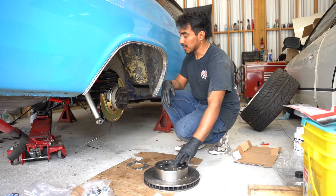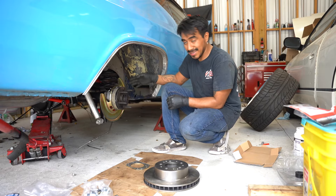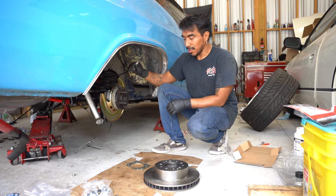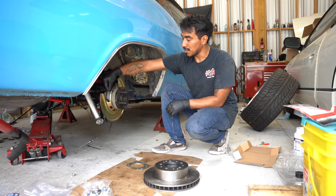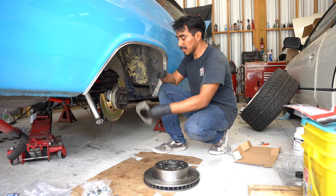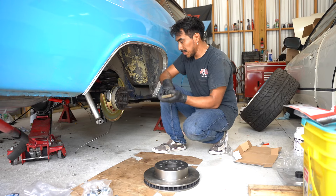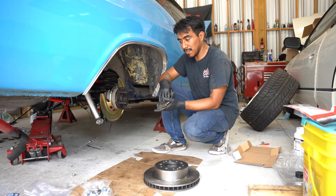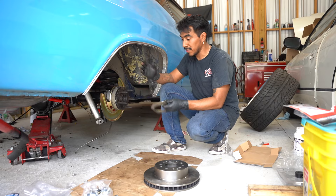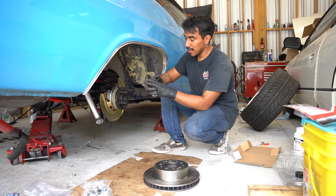Nothing's really allowing a straight path, so we're going to have to run a different route. The harder part is figuring out how to get a bracket on the back so we can put our e-brake cable onto it with a straight shot to the arm. I have an idea based on other cars I've seen, and also a forum post where someone made a clean little L-bracket out of square tubing.